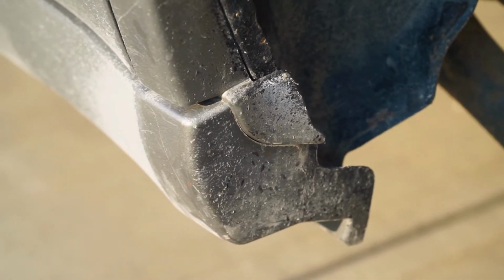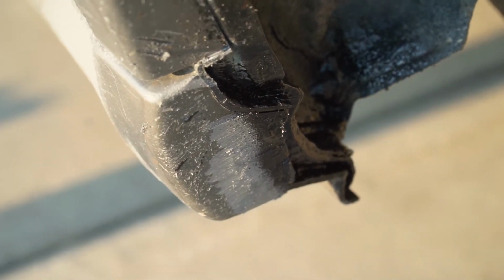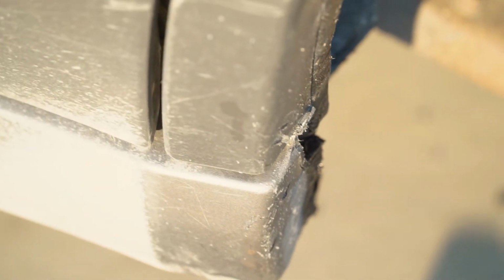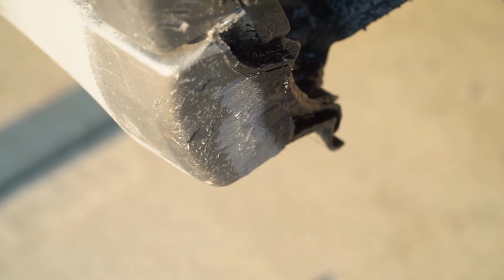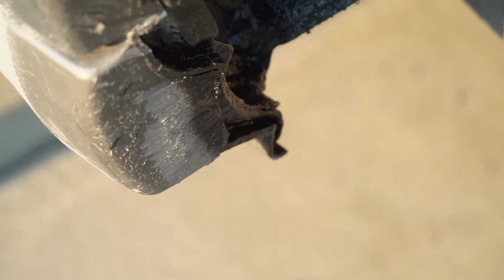And with a little bit of angle grinding and a little bit of paint, there we go. We have it all clearance, and it's essentially up to that middle point now. It's not 100% perfect, but if you look, we should have pretty much as much clearance as we're gonna get, and that should be enough to at least be able to put the tire on and drive it. I don't know about full droop. We still probably will need the trailing arm brackets.